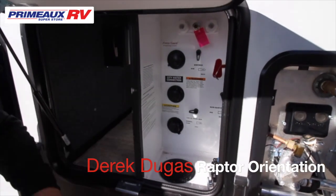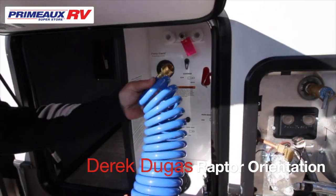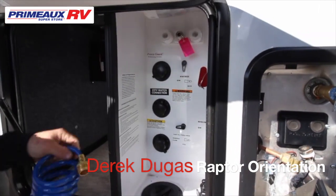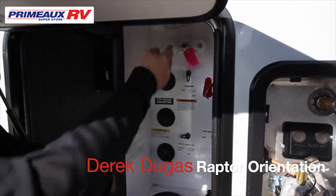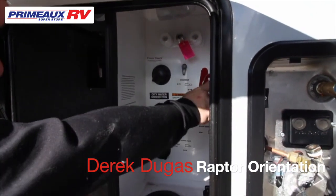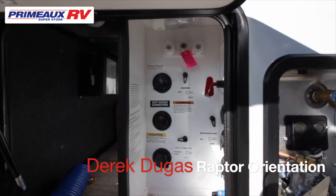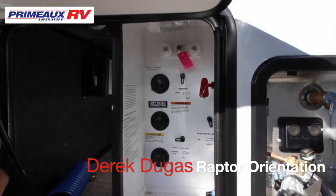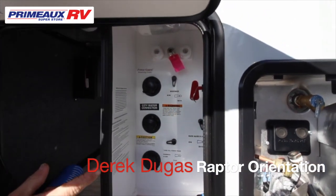Here's all your hookups. So on the top, in your front compartment, you have a little blue hose. This is gonna connect here. You'll have hot and cold water coming out. On top, you have a light. On the side is your battery disconnect. So if you're gonna save this for a while, you're gonna turn that off. That'll kill all your power to your battery except your propane sniffer.